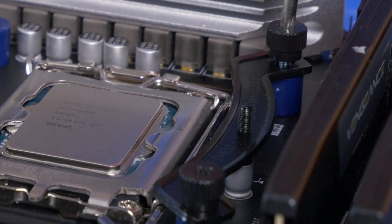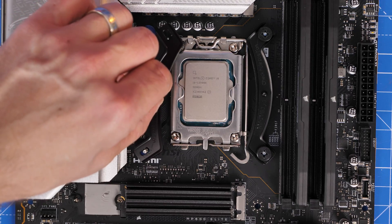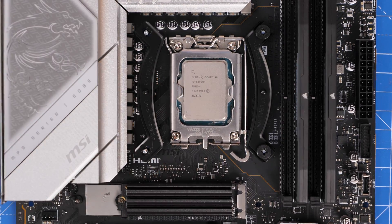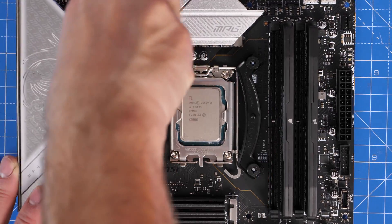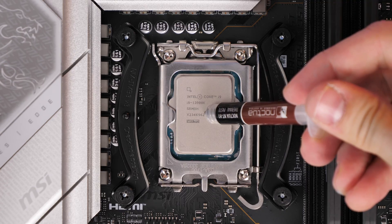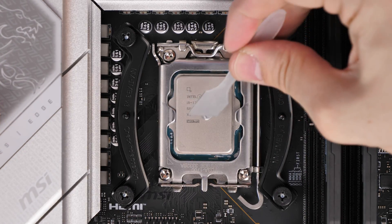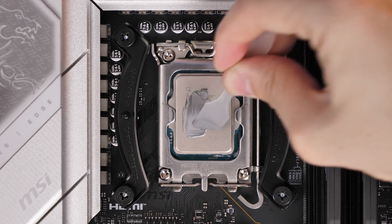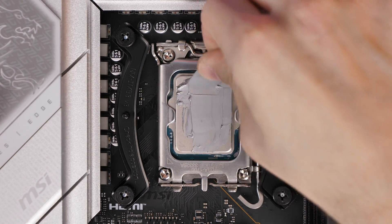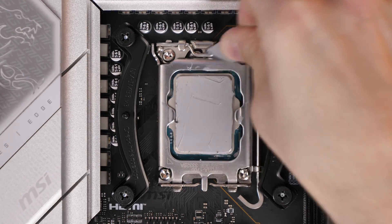It's a little bit tricky to get the brackets in exactly the right place but make sure they're correctly positioned and secured properly — this will be different for different socket motherboards. For LGA 1700 that's the setup. Then apply your thermal paste — I personally prefer to spread the thermal paste across the heat spreader to make sure there's a nice thin layer across the entire CPU for good cooling performance across all of it. Just take care not to make a mess or cause overspill.